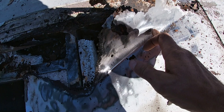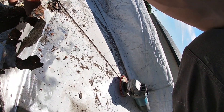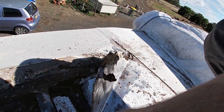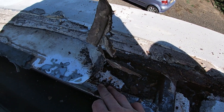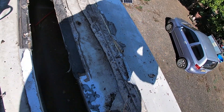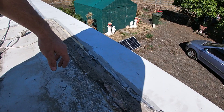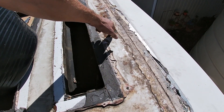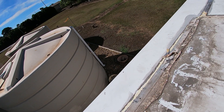You can see here where I've taken it back to bare metal and how far the rust has gone in. On the inside of this sheet it's only gone a little bit, but the main problem is it's spread to the support steel, and from the looks of it it's spread along the support steel that way too. I'm curious to see how far along the support steel it's gone — especially up here, that's really rusty. If it's gone the whole length of the bus or not, and if it has, it's going to be a really big job to fix. On the other side I haven't started work yet, but there are big rust patches up there too, so we can assume it's done the same thing.